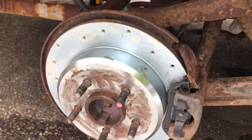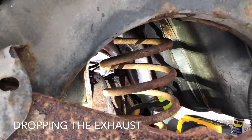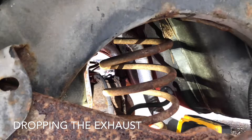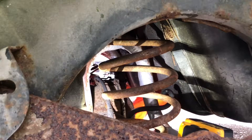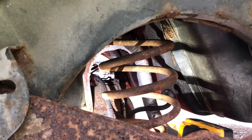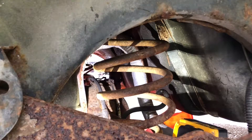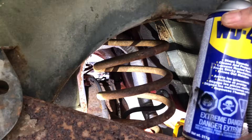Brakes are still shiny, so that's some good news. I've just dropped the exhaust down off the brackets, which gives me a bit of leeway to maneuver a little bit, so let's hope that works out. Easy way to do that is to use WD-40 and literally slide it off the exhaust hooks. WD-40, in this case, is a must.